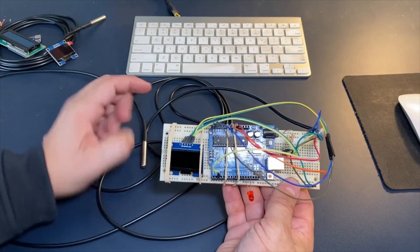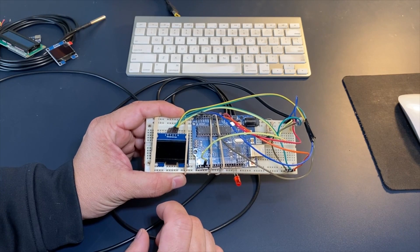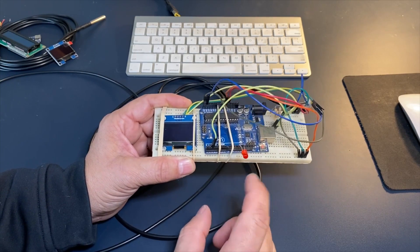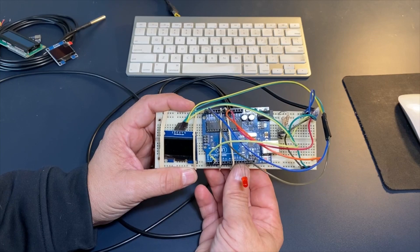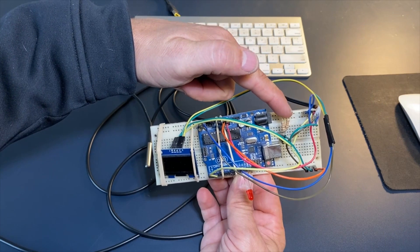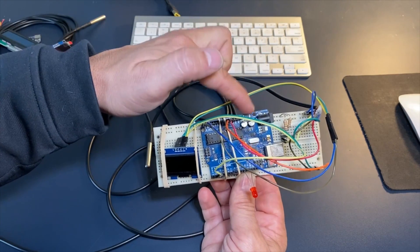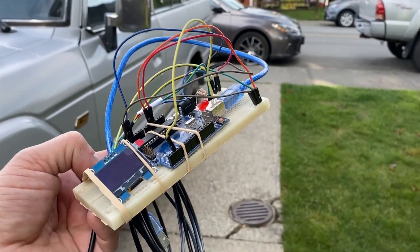This is the prototype layout I have here on a little breadboard. I'm using the Uno because it has standoffs and prototyping is really easy. In the program I put a little idiot light which will go on when the temperature is over 95 degrees — you can set that to whatever you want. One thing to note about this sender is it's going to need a pull-up resistor, so I have a 4.7K ohm pull-up resistor. This helps enhance the signal coming through the long wire so the Arduino board can actually read it.